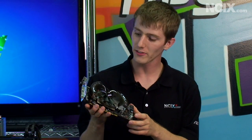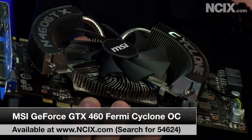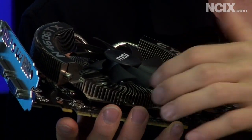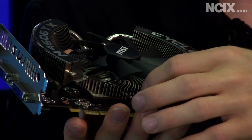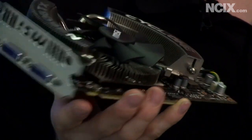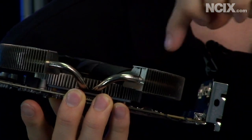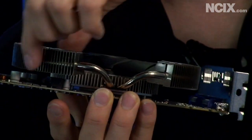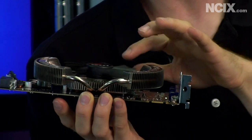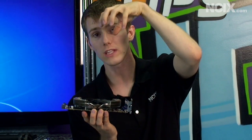So let's have a quick look at the star of the show today — this is the N460 GTX Cyclone. The Cyclone cooler is actually a lot like the stock cooler in some ways at a deeper level. You can see the bottom part here where the fins split out into two fins from one that eventually converges on the center. The difference is that the Cyclone cooler doesn't have a shroud. Instead, it has two heat pipes that come out the top and move into these curved fin arrangements that go around the outside of the fan. These carry a lot of the heat away from the GPU core, bringing it out towards the edges of the fan where it gets airflow not only downward for the main heat sink but also incidental airflow out to the side. That's how the Cyclone stays so cool.